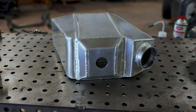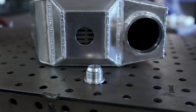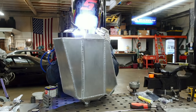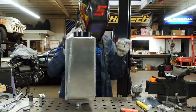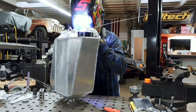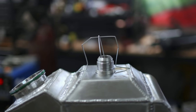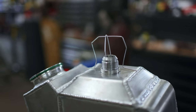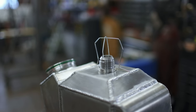We can make progress on the intercooler though. I showcased in a previous episode that we need to weld on these Dash-16 bungs so that we can actually attach hoses to the end tanks. I had mentioned at the time that I wasn't really excited about welding these on myself - this intercooler is front and center in the engine bay, all the welds need to look really good, and I am an amateur at best. However, I'm feeling more confident than ever before, so I figured why not give it a try? The first fitting was straightforward, but the second one doesn't actually fit in the hole that I had drilled previously. So I used some aluminum welding wire and built a little jig to hold it up into place using some spring tension, as I couldn't use magnets or clamps to hold it and still get access to weld it.